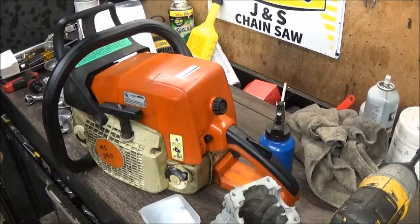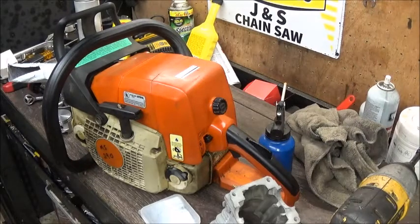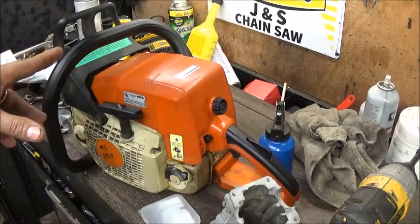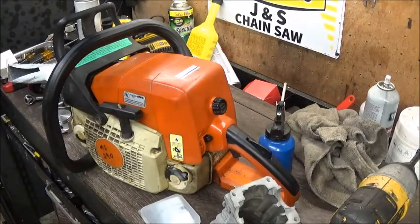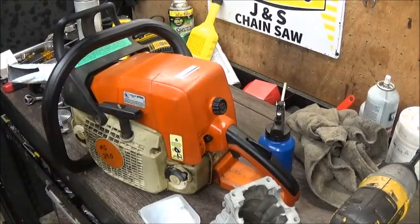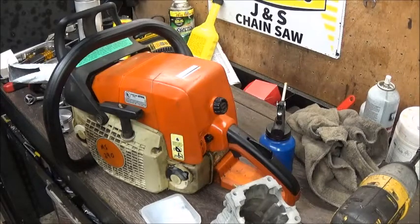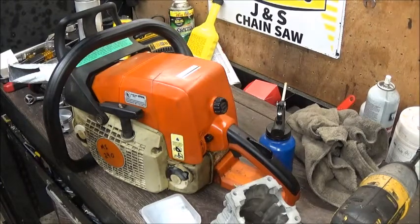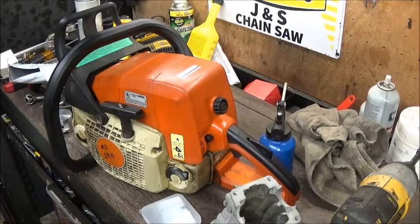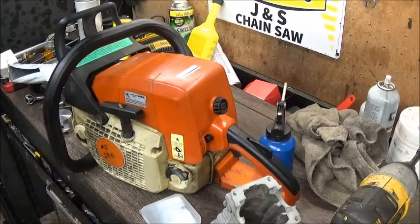He sent two impulse lines and fuel lines up here to me - they were both identical. But this one was already set up for a rim sprocket, and I know he's gonna want to run three-eighths chain on this with the big bar. It does have the adjustable carb. The other one still had the same spur sprocket and the carb has the limiters in it, so I figured this one would be the better one to build. I've actually sold the saws I had in this series - we did a little trading and basically I'm trading a little work for a nice saw.